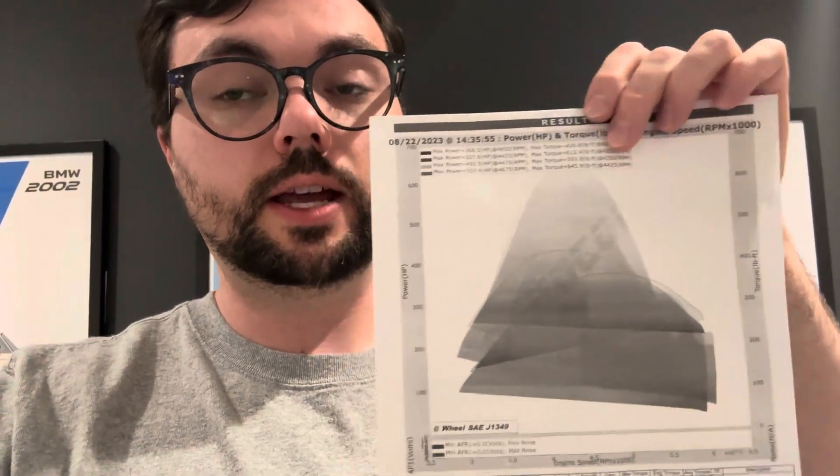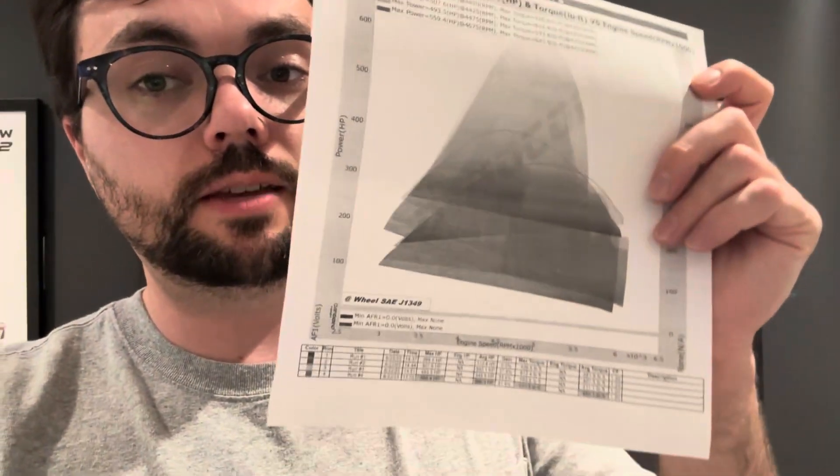I would like to do a camshaft upgrade to move that peak torque up, because that much torque this low down in the power band is really hard on stock internals. If I could keep this same 600 pound-feet but move it up, my horsepower would go up. If I could make it happen at like 5500 or 5700 RPM, the power would just extend out. Torque, RPM, and horsepower are all related — so if you can move your torque, you can move your horsepower.